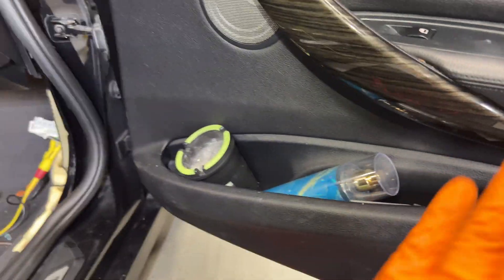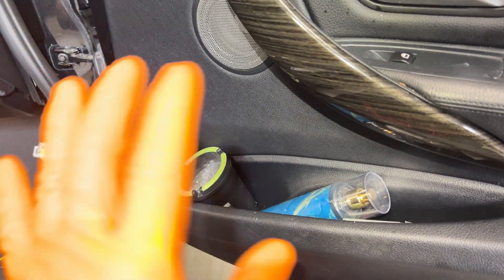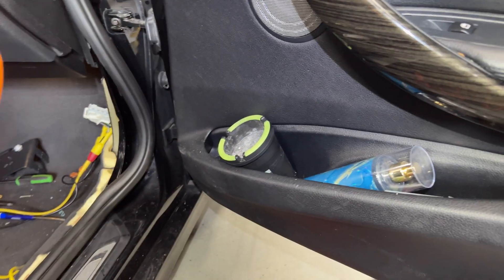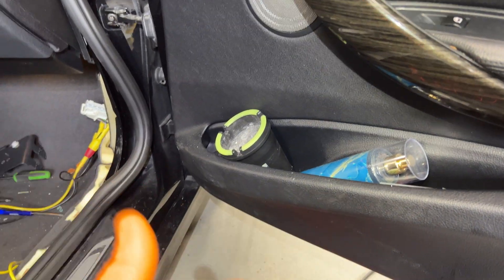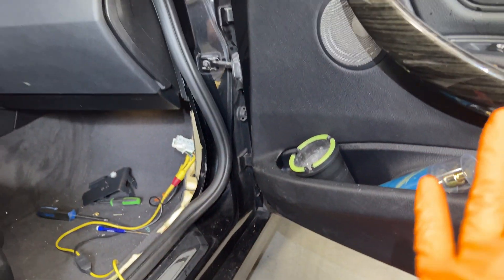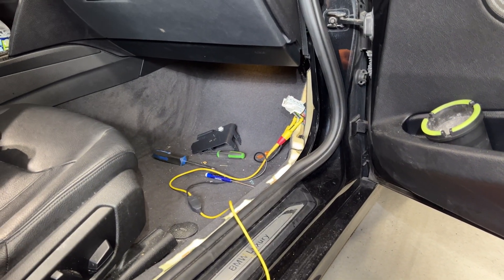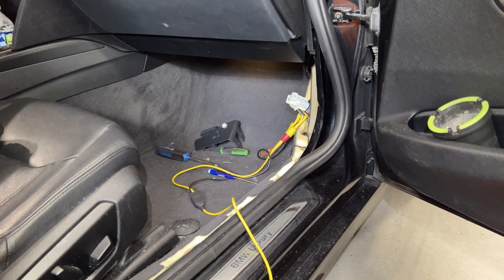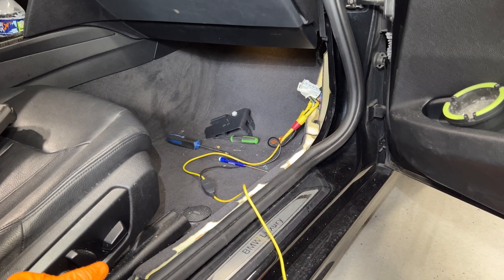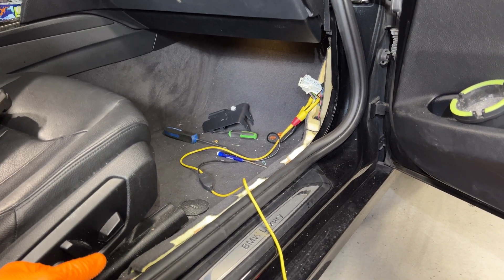Now I'm going to have to remove the door panel. My recommendation to the customer is to get the motor replaced. If I open the door and the harness is good, I can just swap the door lock and we're good to go. But this is the test you want to do before you open the door, because these FEMs on BMW are well known for failure - BCMs, FEMs, footwell modules, just name it, they're always failing. That's why I took this diagnostic approach and wanted to share this with you. Don't forget to subscribe - see you next time, bye bye.